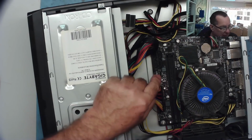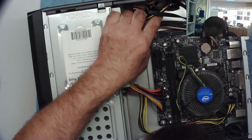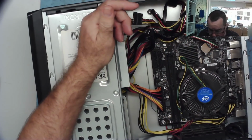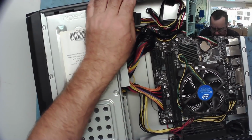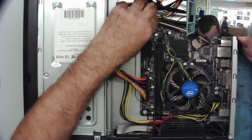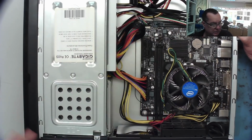And we try and switch it on. And there's no RAM in. There's no bleeper on this. No. If there is a bleeper, I can't see it, and it doesn't do anything. So, we'll unplug the power. I'm going to get the motherboard out of here anyway, get us onto the workbench with a known good power supply, and then let's see if we can figure out what this is or isn't doing.